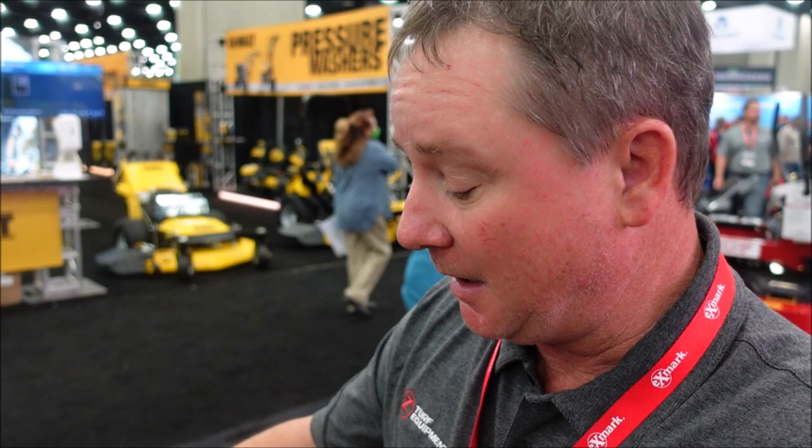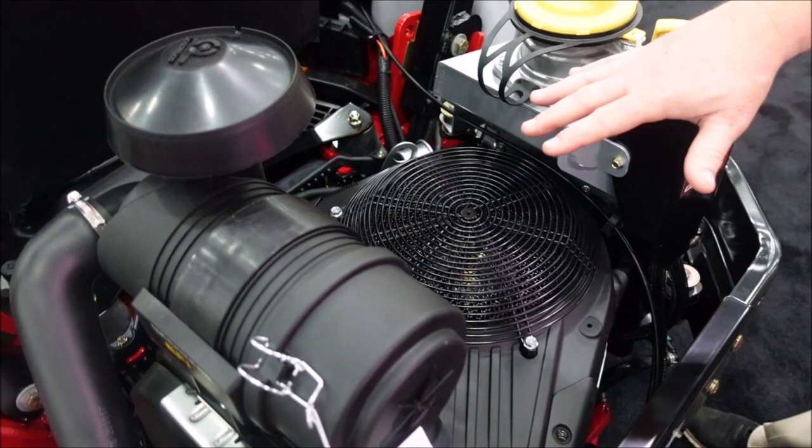Along with that, this gives so much durability and reliability to the engine. You have a big reservoir, a ton of oil going through — it doesn't sit in the sump, doesn't suffer from cylinder wash. So the oil stays cleaner, cooler, keeps its viscosity better. That lubricates the engine, engine runs cooler, that also helps the oil maintain itself. So it just kind of feeds upon itself to give us a great durable, reliable engine for hours and hours into the use of this machine.